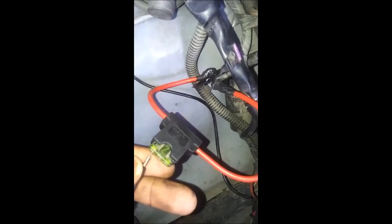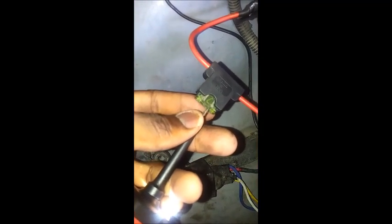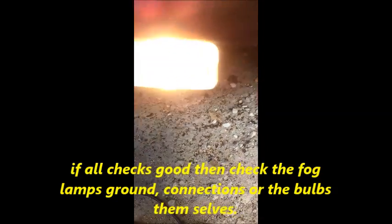You can test it here first, then you can test it here at the fuse to ensure the fuse is alright. So far so good guys. Now we're gonna look at the wire that leaves and goes out to the fog lamps - we're gonna test it here and show that we have voltage in it. We got voltage guys, so that means our fog lamp should be on. That's basically how you test it - you could also test from the wires behind here.